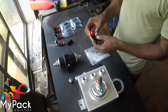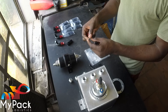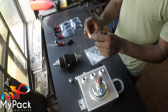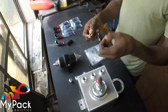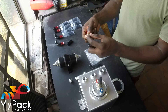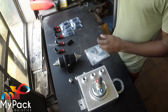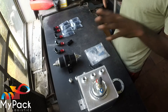But the Teflon-type braided line isn't designed like that. This one has an expanding ferrule. What happens is you put this over the braided hose, then fit the ferrule onto the Teflon piece, then you put this in and on screwing it up it will compress this and create a seal so the hose stays together. These are the fittings we have — I'm going to put this together and show you how I plan to map everything in the car.